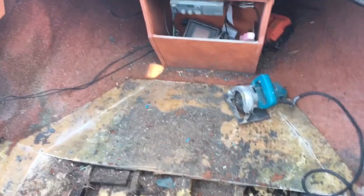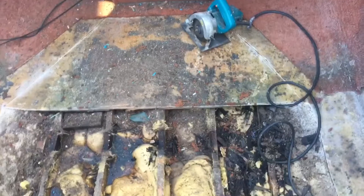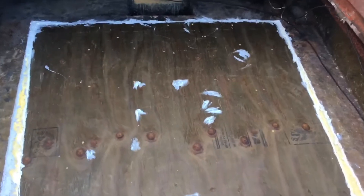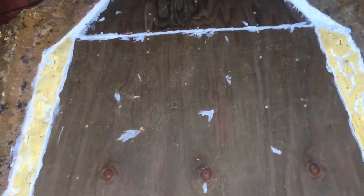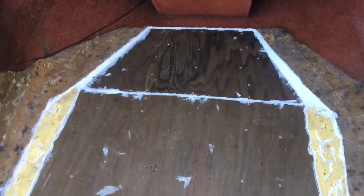It's coming along. I need to have it ready for fishing this summer - I love fishing. As you can see, I patched the floor, put the new floor with new plywood, treated it all the way and sealed it waterproof. I put it all the way to the front - if you have an idea you can do it yourself and save money.